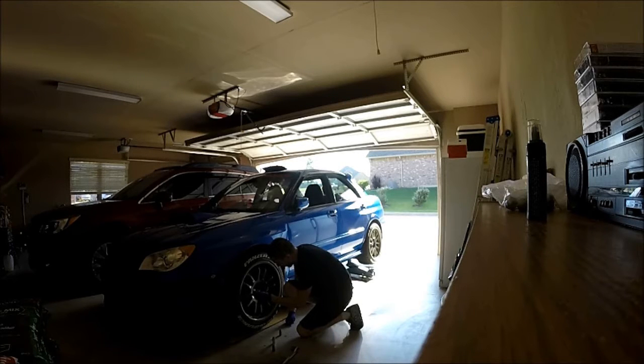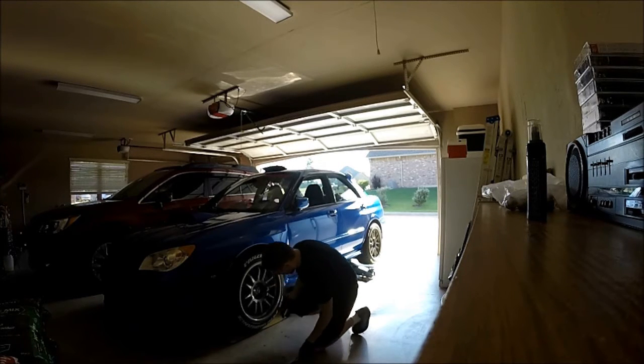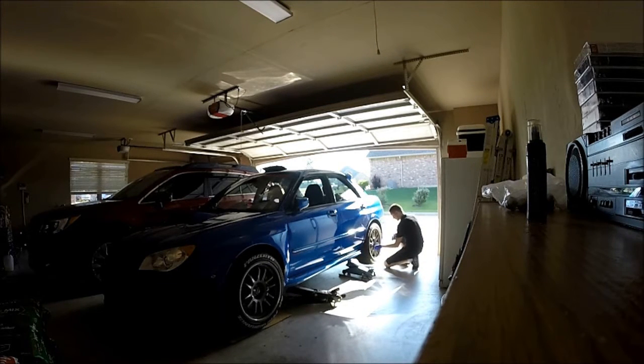I was checking the camera to make sure it's still on. I really wish the lighting would have turned out better. That's the last lug — usually those are the hardest ones to get off because the most pressure is on them as the tire starts to come off and pushes up against it. So now the tire is just hanging there on the threads. Loosening the other side — since we already broke them loose they won't be ridiculously hard to get off.